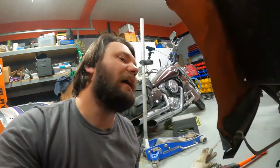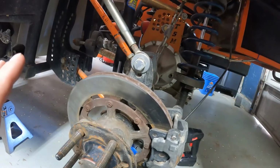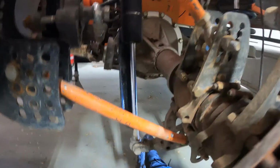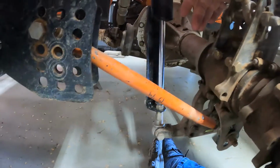So basically what happened is when this chain breaks, it allowed my left rear to drive forward even more, way too far forward, until it was limited by the bird cage. And once it hit that point, it basically pogoed and was driving the whole left side of the car up, which is why when people saw it break, I was carrying the left front like 2.5 feet off the ground.